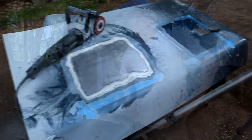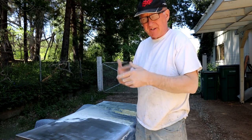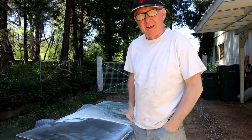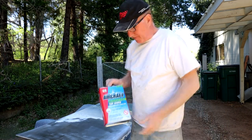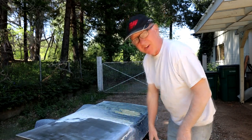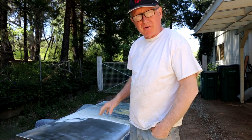It's another day. As you can see I've started stripping this side with the SCT sander — the stripping wheel with the aggressive 40-grit stripping wheel on it. I'm still working with the stripper product — I gave up on the Jasco stripper. I think that's more orientated towards wood. So I went to the aircraft stripper by Clean Strip, which is particularly formulated for metal and supposed to work in about 45 minutes. It definitely is better — a little more expensive but definitely better.